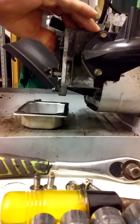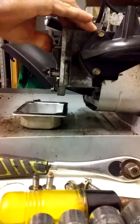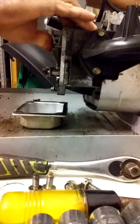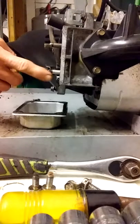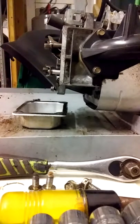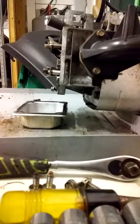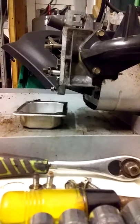The bottom has not moved yet at all — that's the intake. There goes the exhaust. Coming back around, there's the exhaust again. So that's the reason it wasn't firing — it wasn't sucking anything in, and it wasn't pushing any air out the exhaust, because the rocker arm was off of it. That's a camshaft right there. I'll have to get a camshaft.